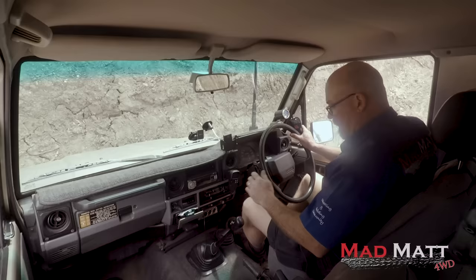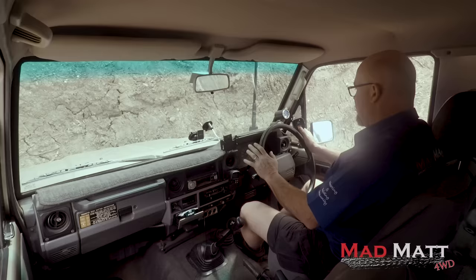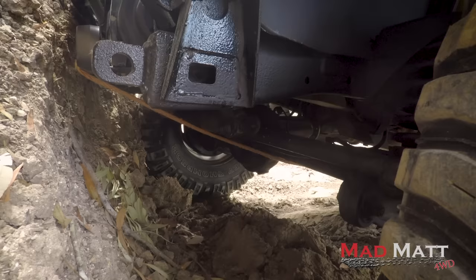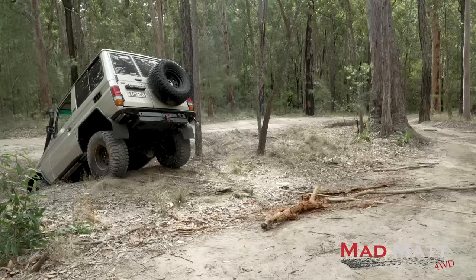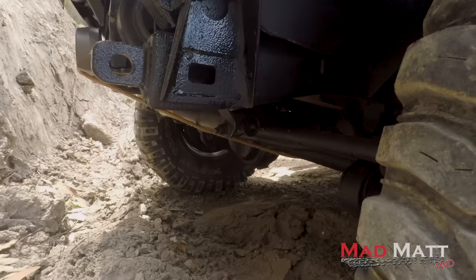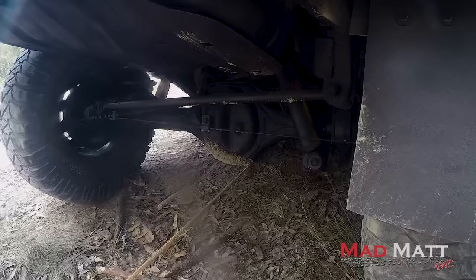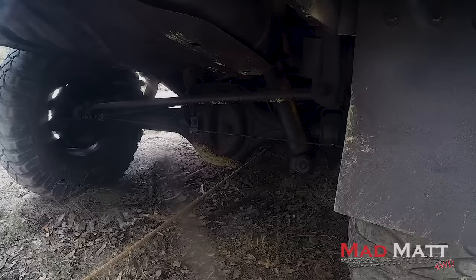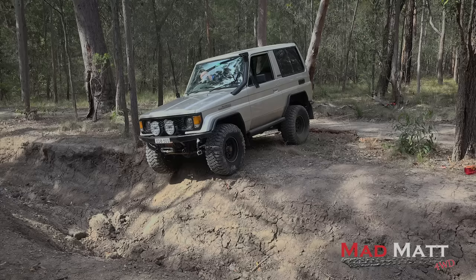Time to have a crack. I can't put my seatbelt on because I'm on too much of an angle. The way I'm going to do this, I'm just going to let the winch do all the work. I'm not going to drive because the reality is the Bundy would drive straight out of this. Winch in. There she's taken tension. She's starting to go back - look at that! Easy. Your winch won't have as much power as it normally would because it's going to have a lot of frictional loss going across the fair lead, because that fair lead is going basically backwards on itself. Look at that - so that's how easy that's working.